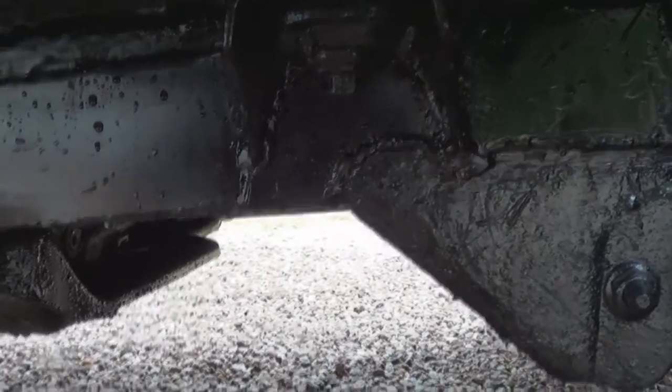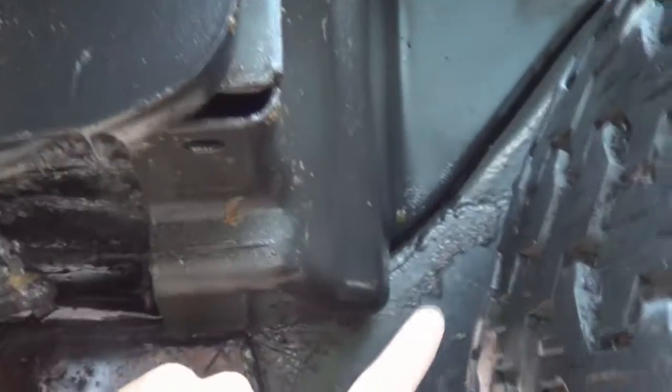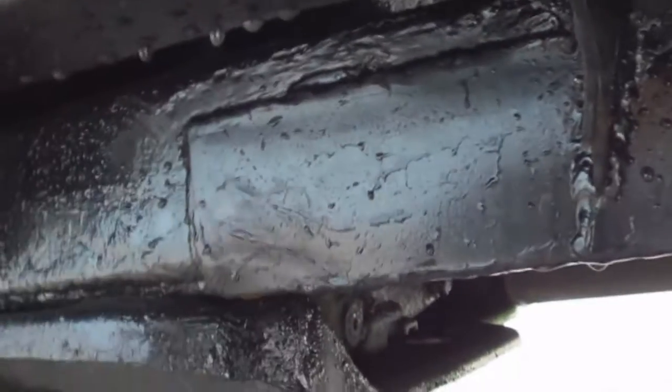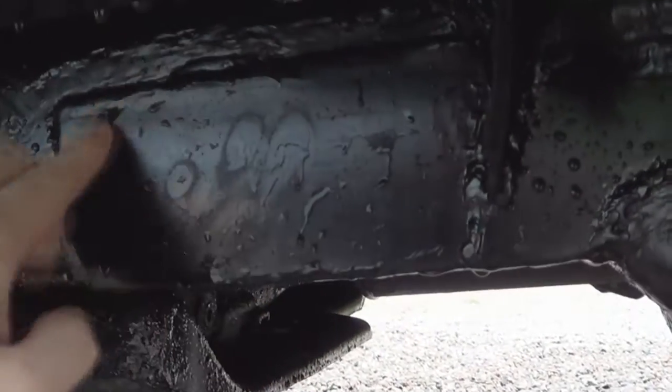This is hopefully the last frame weld I'm going to be putting into it for a while, at least a good year and a half. Frame here has been welded, 3/8 inch plate, all sides, all the way up to here, all the way to meet this. This is the very first weld I ever got on the Jeep that needed it immediately as soon as I picked it up. And it finally connects into here, and I think that's where the stock running boards would normally be mounted. There they are, like these on here, and it was always screwed up over here. It had a really bad patch weld on it that I didn't put on originally, so that needed to get done, and that got done, so I'm pretty happy about that now. The Jeep is structurally sound again for the third time now, and I think it'll last a while this time.